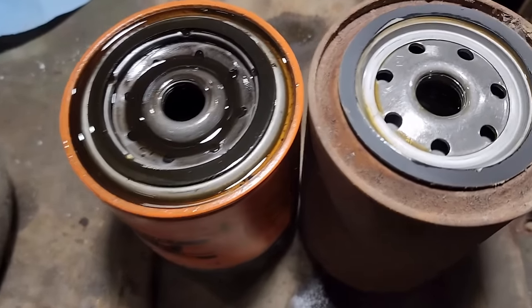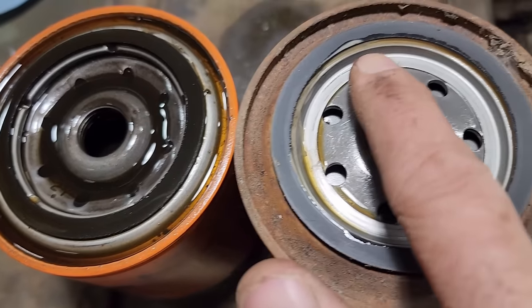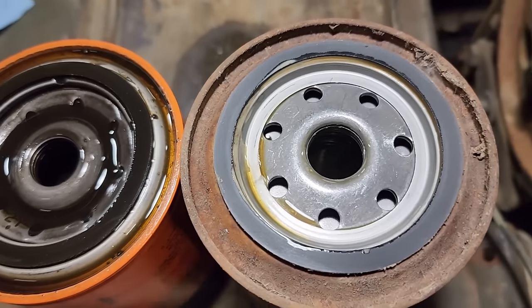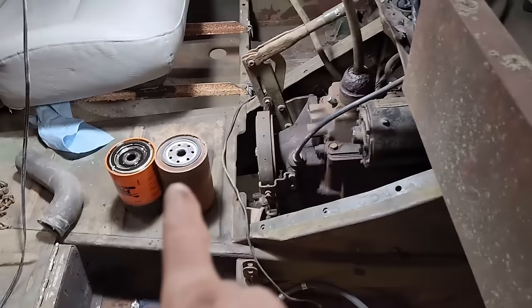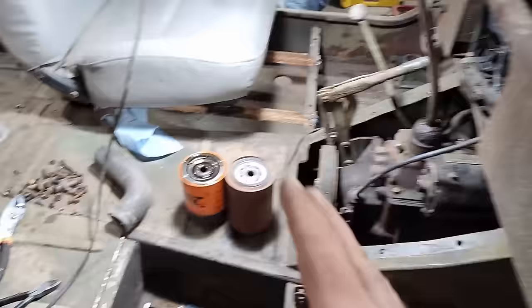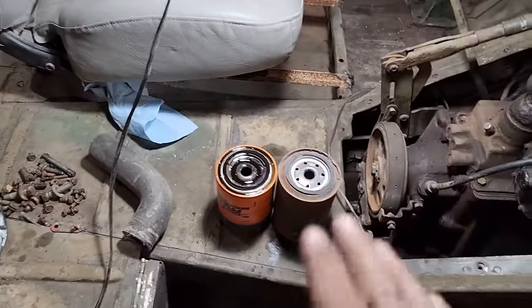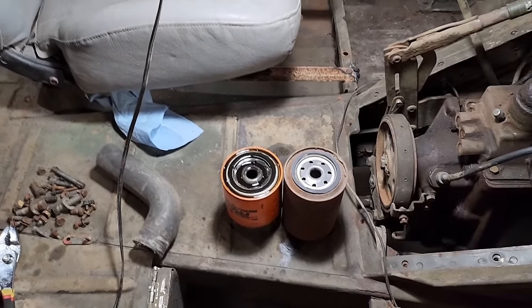And I think it'll pick it up, yeah, right in there, that milky looking substance right in there. I think that perfectly illustrates why I'm putting the used oil in it, because every surface inside this engine is coated with a layer of that crap. So why put good oil in it just to have it carry that out? Dump this used oil in it, run it a little bit, dump it out, and it should get what's left of all that milkiness out of there, in theory anyway.